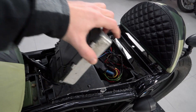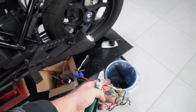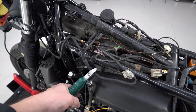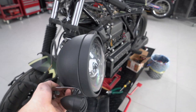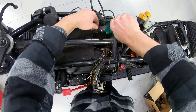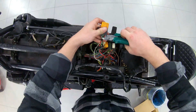They are connected through a relay, which we immediately cut off. We also threw out the aftermarket connectors. Handlebar switch controls can be disconnected. We cut off the headlight — it makes no sense to disassemble it anyway, as the wiring will be new. We remove all unused connectors and cut off the relays. During reassembly, we only need the temperature relay with the purple wire, which controls the radiator fan. The rest are not needed.